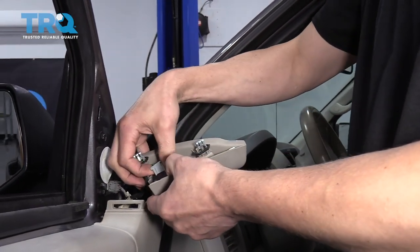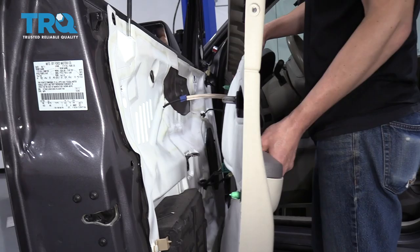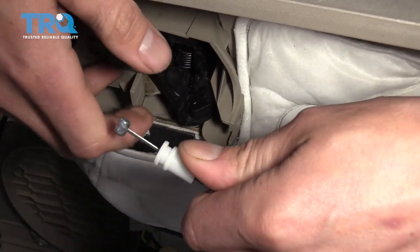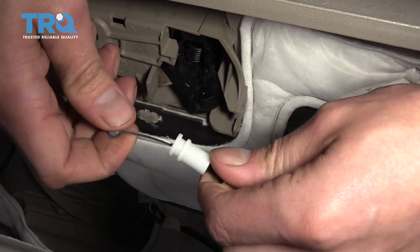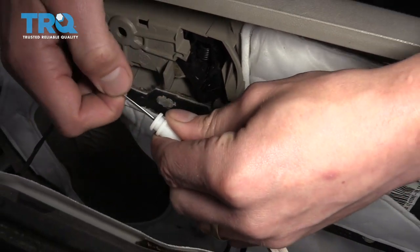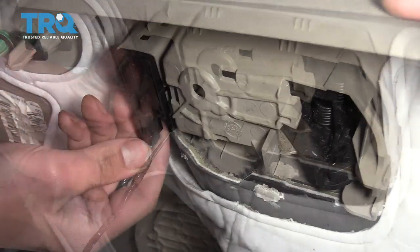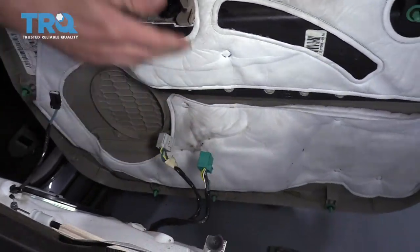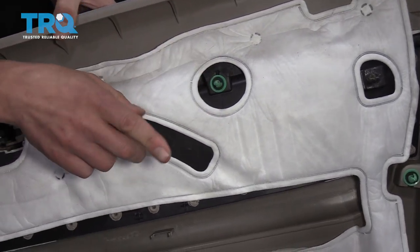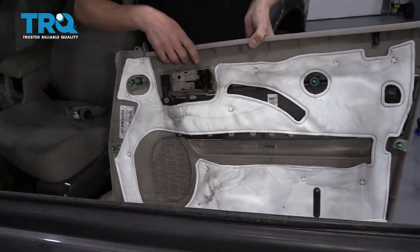In this case, we have a mirror switch that we'll have to disconnect. Then you can just kind of pull the door panel off. A lot of interior door handles have cables that go to them — from the handle itself down to the lock — and most of them work like a bicycle brake cable. It clips into the door panel and then has a little end that slides into the door handle itself, so it's very easy to remove and usually doesn't require any tools. We also have some additional clips — you just push the tab on these to release them. You can see these are the types of clips you'll find on door panels; they just push straight into the door. Another option is the kind that hooks downward, and in that case you have to lift the door panel straight up to get it off.